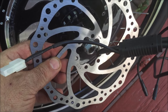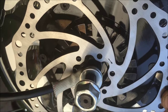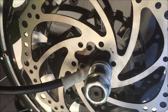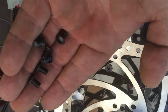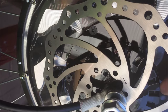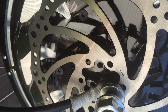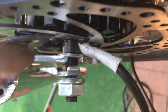I had to feed all the wires through before sliding it onto the axle. The disc is ready to go on — I'm using a 180. The disc is designed to spin in a certain direction, it has an arrow on it indicating the correct rotation. Also, you must use the screws that come with our brake discs — if you use screws that are too long, they go through the housing and rub on the controller inside as the wheel spins. The correct screws look to be about 5/16 of an inch.